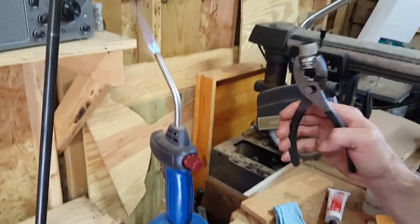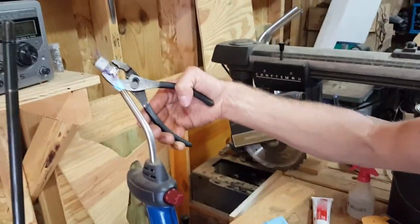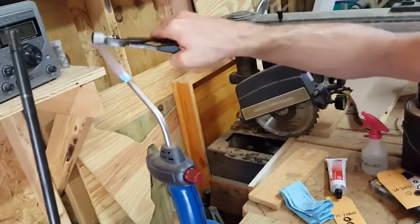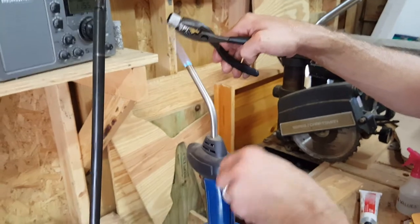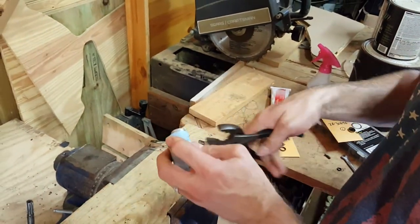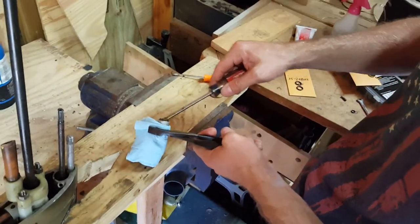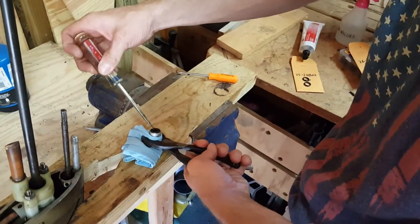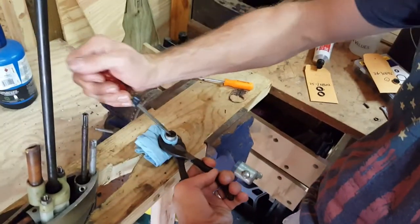So the first thing we're going to do is warm this bushing up — I have a torch going. I'm just going to gently warm it. All we need to do is release the sealant that is holding the old seal to the bushing. Get it a little warm — don't fry it. This thing is going to be hot. I don't want to damage the bushing, but I'm going to need to apply some force. I've got a screwdriver here and I'm just going to gently tap it around. I can start to see some movement in that seal — it is coming off the bushing.